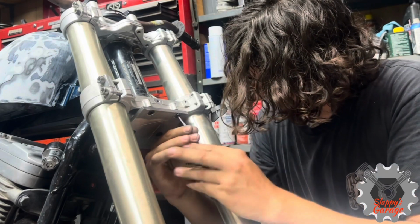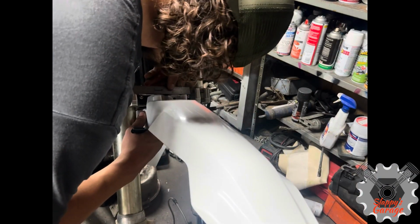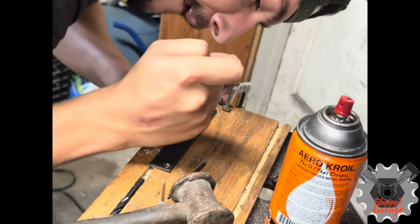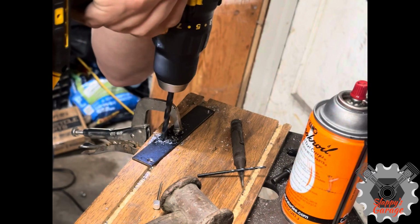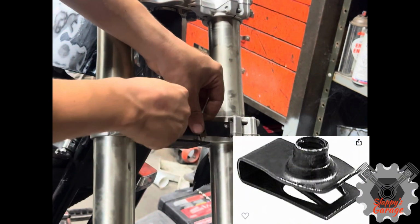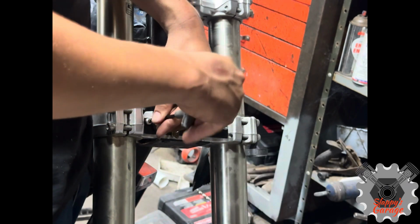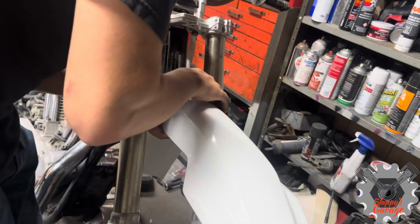So when I'm installing this front fender, I'm going to put the two brackets on. I'm going to lay the fender nice and center, and I'm going to mark the holes so they're the correct height off the bottom to the top. Okay, once these are done, I'm going to install some U-clips. With the U-clips installed, I put the front fender mounted on using the bottom bracket and the top, and I can line everything up to drill the bottom two bolts.